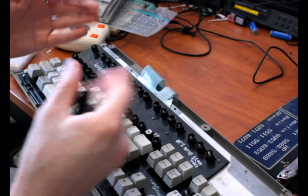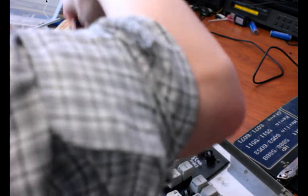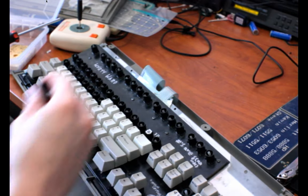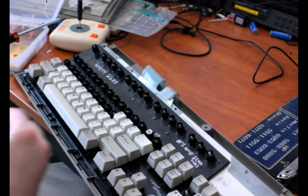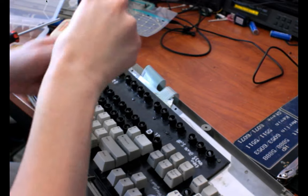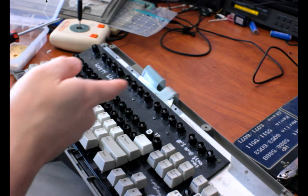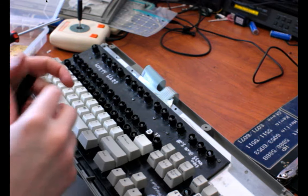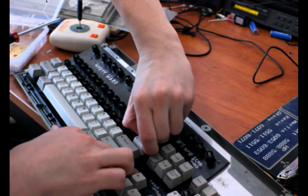By the way, if you haven't done a bolt mod before, you basically have to chisel all the rivets off, and then drill through the holes in the steel that are underneath, after aligning it correctly so it goes straight through. And make sure there are no bumps that protrude outward from where the drill went through around the edges of the hole, because those can cause problems with the membrane and key switch actuation, which is what happened over here with the do not use hole.